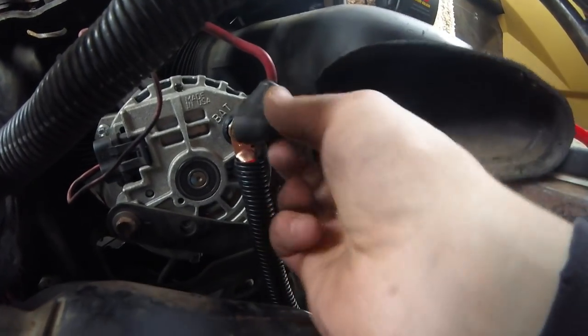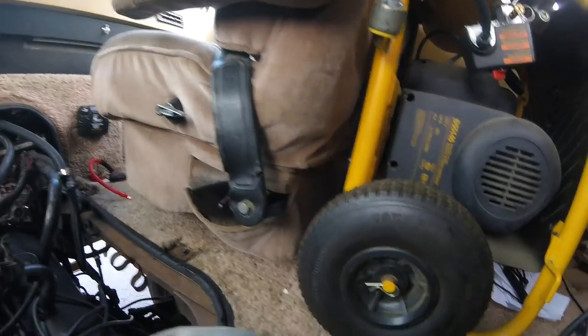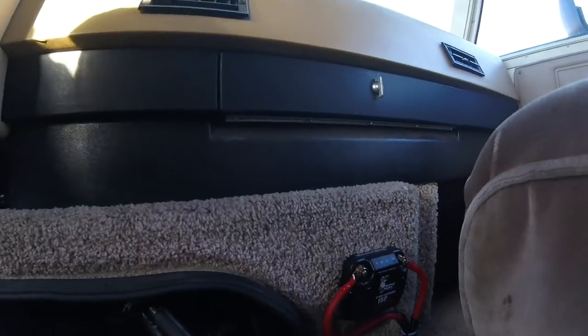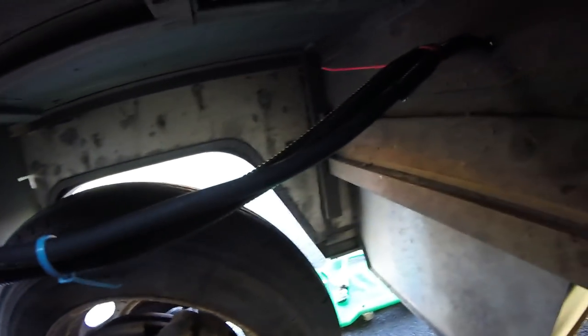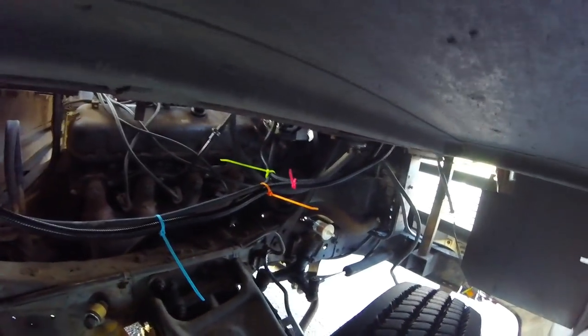First connection is made. Ground wire going to the battery bank — just need to run that straight to it. Positive will go up to the isolator and then from that we'll run alongside this into the cabinet. Got the device grounded down here, just in between the two holes I made for the cables to go through. There'll be my new charging cables — put some lugs on.